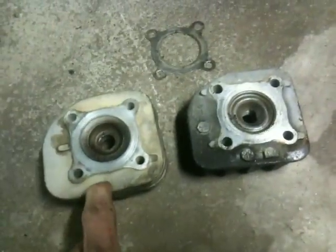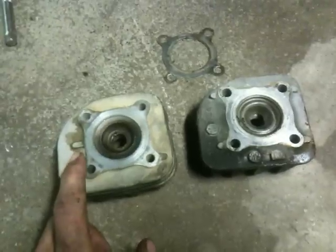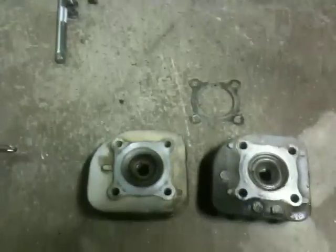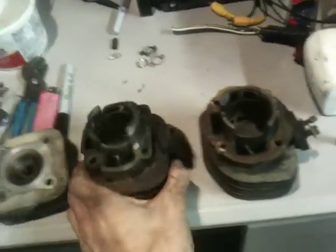So I'm going to go with the Vento head, which will give me the higher compression. Basically it's going to be just about the same except it's got a tad bit better quality jug and a little bit better piston - it's a new piston, basically low mileage and in really good shape compared to my high mileage one that's got blow-by. This high compression head is why the Ventos are much better, or faster I'll say.